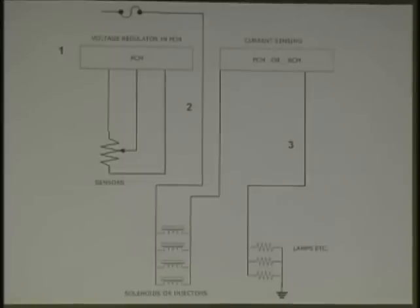In any case, once the amperage comes, the computer notices this right away and shuts it down, almost instantly. So once you disconnect it and it senses that it's okay, it'll come back online. You may have to turn the key back off and everything, but then it'll reset. Back online. It'll reset. Any questions on that? Let's go on here to BCMs with lamp detection.